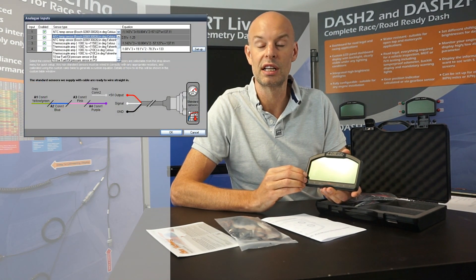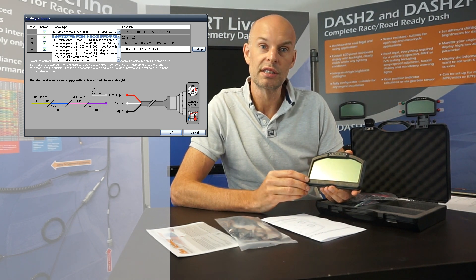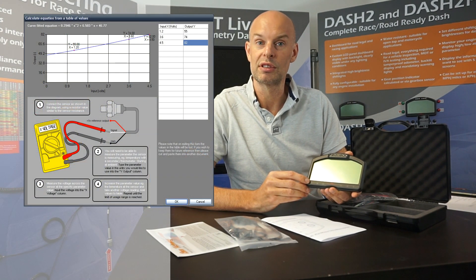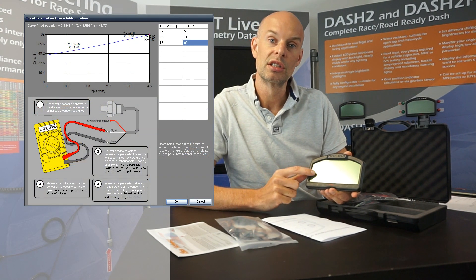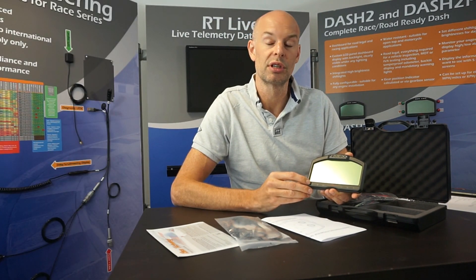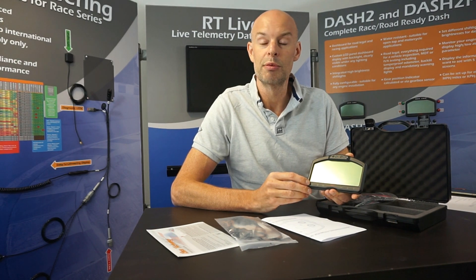You just select the relevant sensor from a drop-down list and it's all carried out for you. If you use your own sensors then the mechanical installation is much more straightforward because they're already fitted on the engine and already sealed. But because the dashboard doesn't automatically know what the voltage means, you then have to set up your own calibration to convert that incoming voltage into a useful display of temperature or pressure. So mostly if there are already sensors on the car you use them; if you're adding additional sensors you'd normally buy them from us.